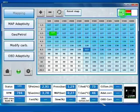So you see, here we are, and this is a good calibration. When you have values below, I think, 5 or maybe even 10 points on idle, you are not so far from the right calibration, so you can leave the numbers as they are. But if you have more difference, I mean, for example 20 points, you should change this map.